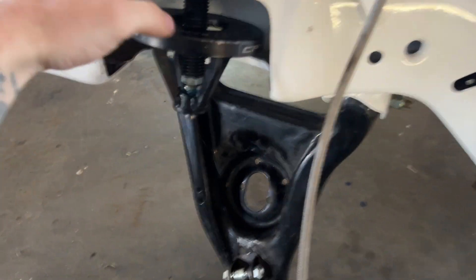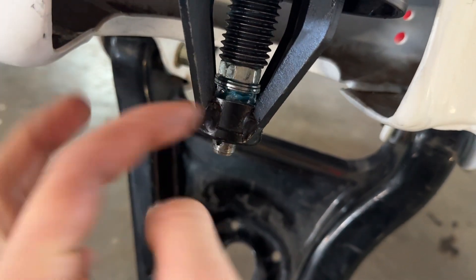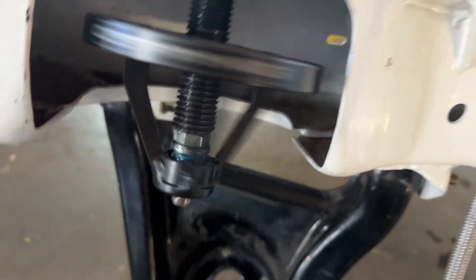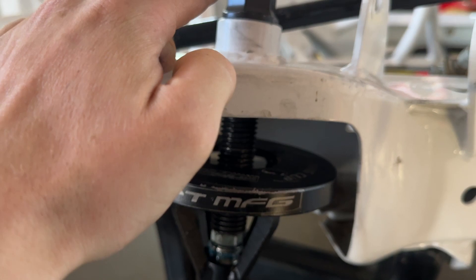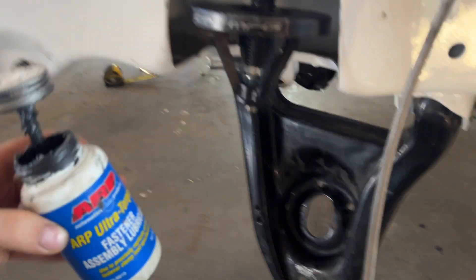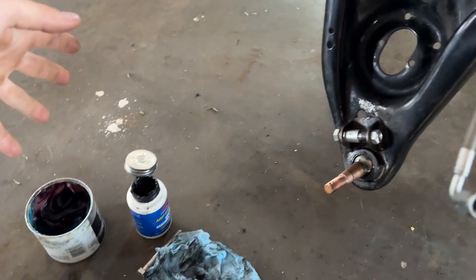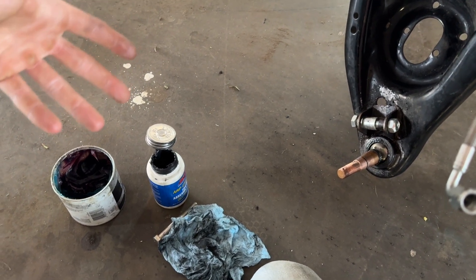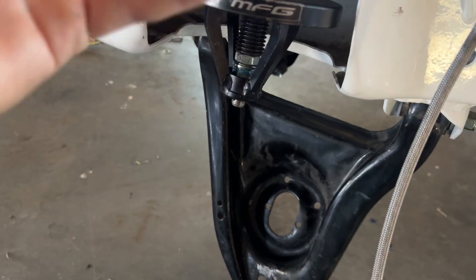Both lowers are on now. I got my spring jacks in there — these have a little Torrington bearing. These are CPT manufacturing. I took the little washers on both sides, greased those up, then greased the bearing up. For the threads, they're starting to get some surface rust, so I took some ARP lube — I just bought this bottle, and you always get the packets whenever you're putting stuff together. I put it on the threads because that's to keep things lubed while there's force on it, so you get an accurate torque number, and this obviously has a bunch of force on it.